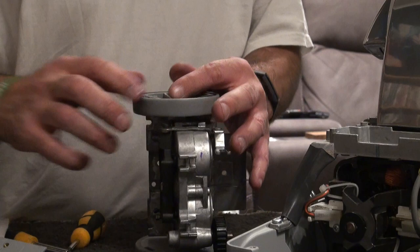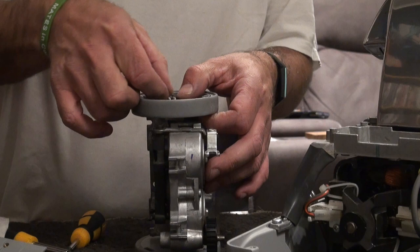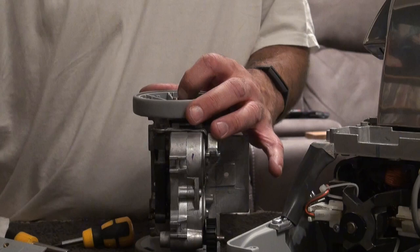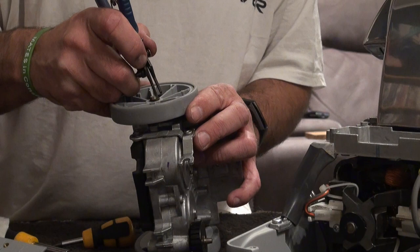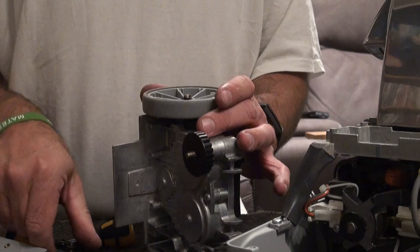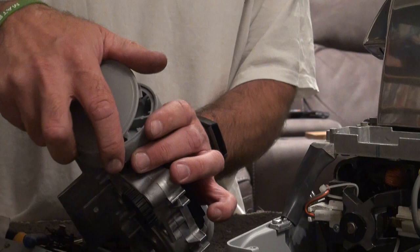Again, get our split clip. Where the two prongs are. So again, I don't know if you can see. Two little prongs. That goes on the flat side. Then you just push it over. Make sure it's clipped in. Sounds like it's clipped. And what I tend to do, just get my little pincers just to move it, see if it will turn round. If it will turn round, it's normally in the slot. So you can do that on both sides and make sure it's not coming off. Again, I'll do this side. I can actually see the holes now. Yeah, when we took it off, I couldn't. So that's fine. Okay, hub caps, just line them up with the little holes.